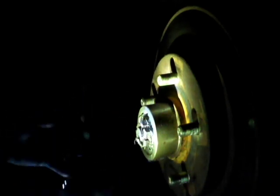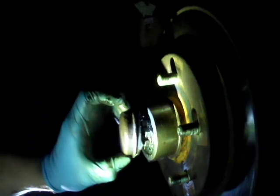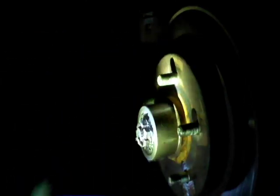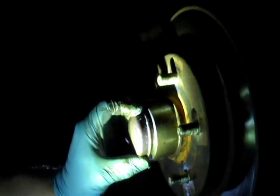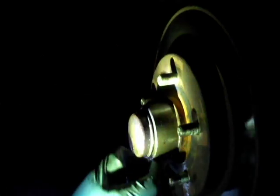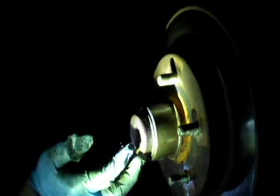Clean out the dust cap just a little bit in the end of the cap, and you want to make sure your cap seat is cleared off good. Go ahead and line that up — it didn't start in straight for me, but these should not be that hard to put in. Hit them with the back of your hand so you've got to hit them even, and you should be able to do them just like that with the butt of your hand.